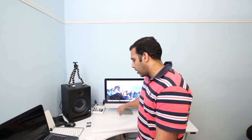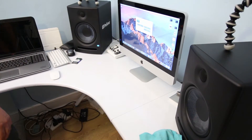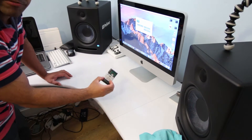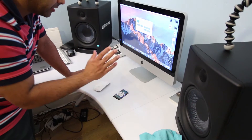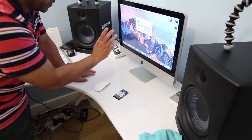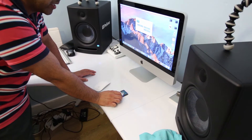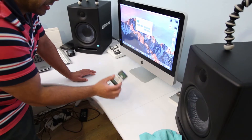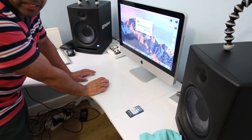First step is to shut off your Mac and make sure you check the specification of what kind of RAM is required for your specific model, then order it. Just double-check before you order. For this model I ordered PC3 10600, 1333MHz, DDR3, 204-pin SODIMM, 8GB RAM module.